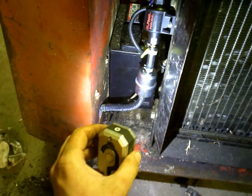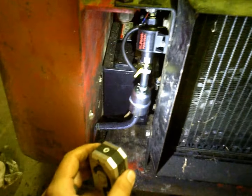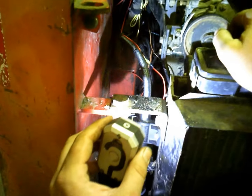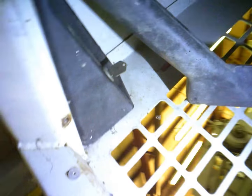I got the fuel filter in there, and I put that before the pump so that if it gets plugged, I'd know it — it'll be starving the pump and that pump will start making a loud clicking noise. Then I ran it up to the carburetor and ran a keyed hot wire down from the ignition switch up in the top corner of the cab, running it through the firewall. I had to leave some slack for when the cab folds up. They had to run another power wire up to the key switch.